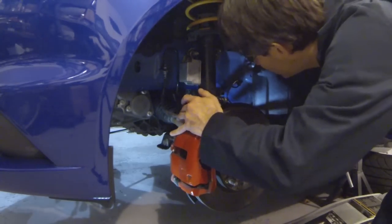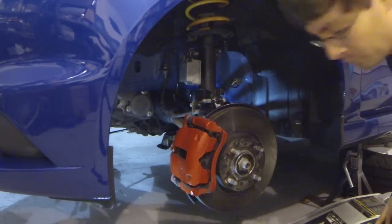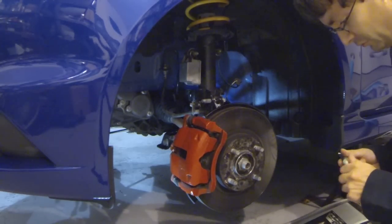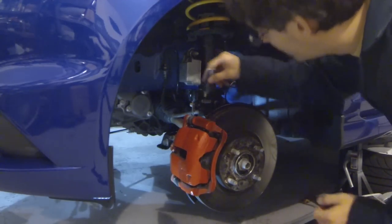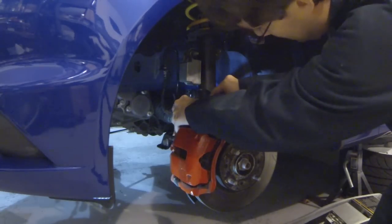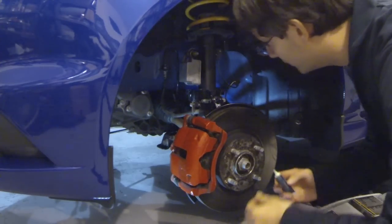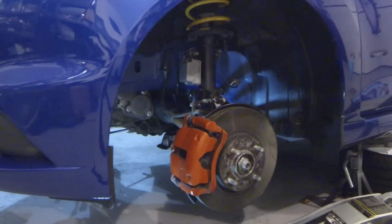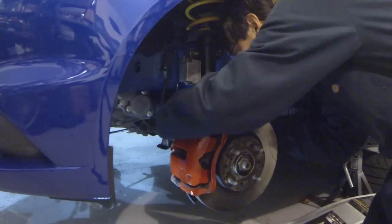Okay, the bolts are already pushed through. We are now going to put a little Loctite on there. As you can see, the bolts are facing forward. This, of course, is the blue Loctite we're going to put on there. This, of course, is a thread sealant. It cures with the absence of oxygen. So after everything is tightened, that's when it will begin to cure.